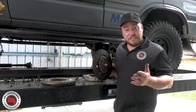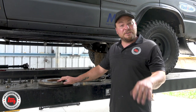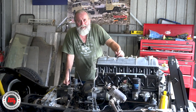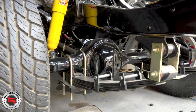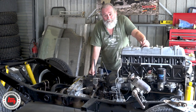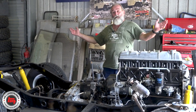We don't usually do it, but we'll be putting this clutch back in the vehicle with a new spigot bearing, and then we're going to get the flywheel machined to give it a nice brand new surface so we don't get any judder. Better get back over to the gearbox and get some of these bearings done. If you look at this ground-up resto on a shorty — probably mid-to-late '70s — this is one the boys are doing out here. Beautiful, but the first thing I noticed was the gearbox hasn't been done up. Apparently the customer drove it up from Sydney and figured the gearbox was pretty good, and he was right.